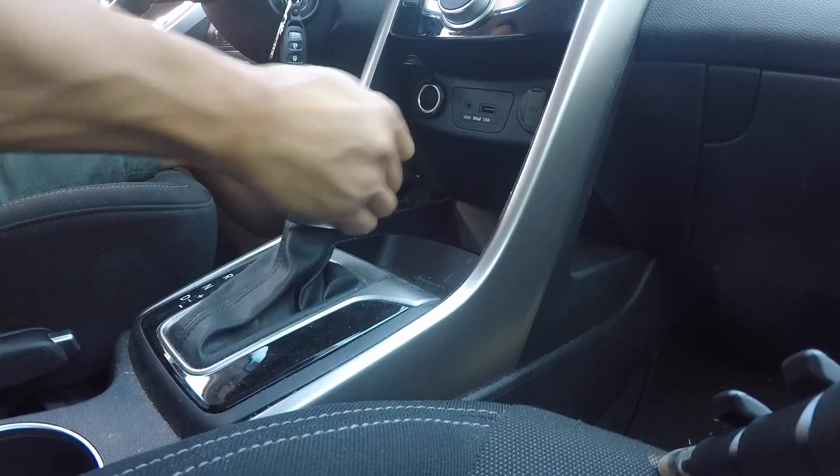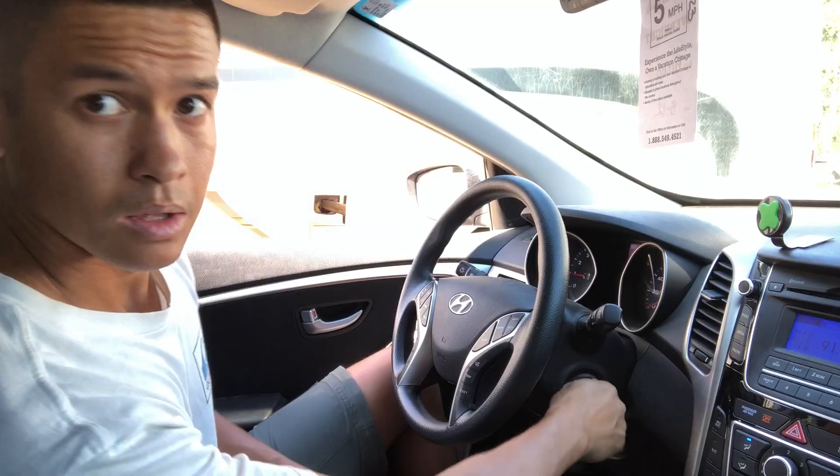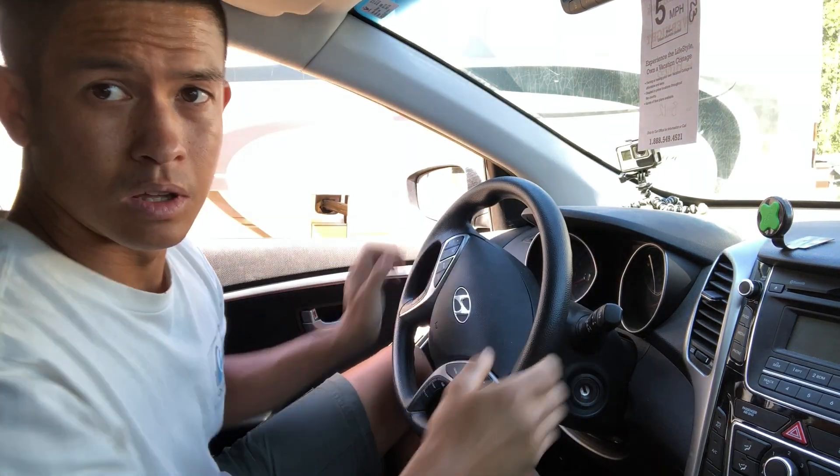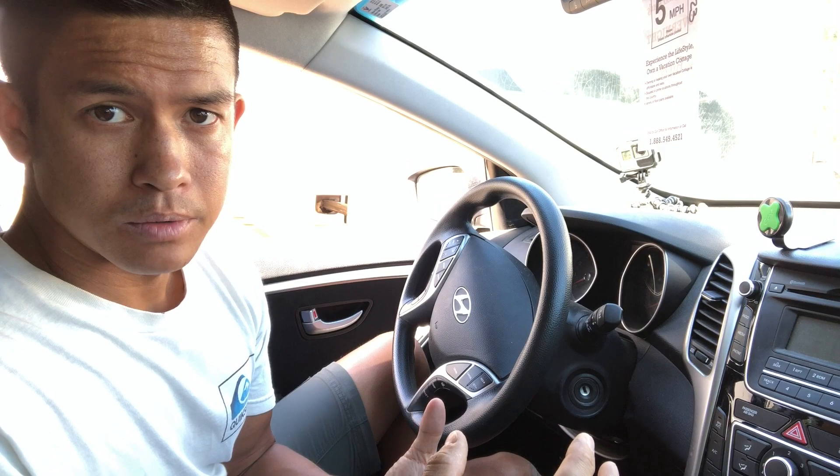Now that the car is up on the car dolly, we go inside and make sure the car is set up correctly. It needs to be in park — I know you're thinking the car needs to be in neutral so the wheels are free spinning, but this is a front-wheel drive car. The rear tires are the only ones touching the ground; the front tires are stopped by the car being in park. If you were to engage the parking brake, that would lock up the rear tires — so no emergency brake. Car in park, emergency brake off, then turn off the ignition.